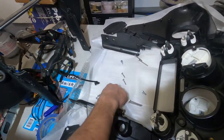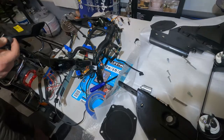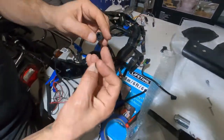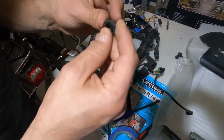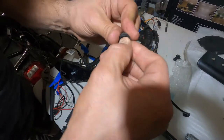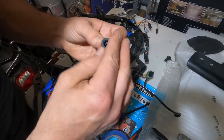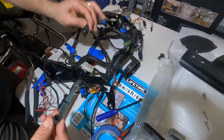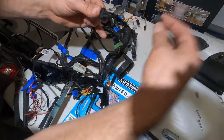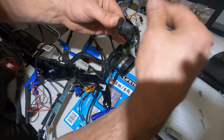Right? And just a quick review here. When you're about to reinstall that button, you're gonna have to put this ring back inside the rubber and have the rubber hug it from everywhere, like this. Let's imagine that we're gonna have the button going through the fairing like this. After you push it in the hole, you just screw the rubber in.